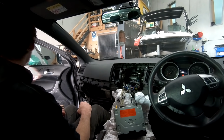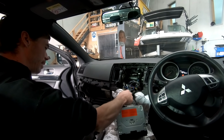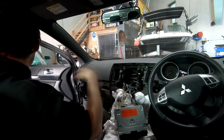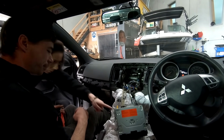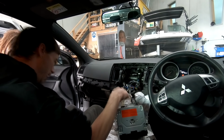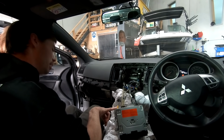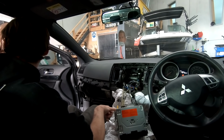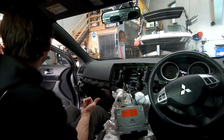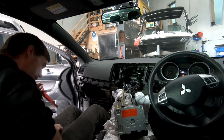Oh, cool. There you go. Are they to go to amps or battery? Yep, they're your signal wires, so they're the RCAs that actually give the audio signal to the amplifiers. Okay. What are these ones for? They're just extras. So that's plugged in there is the camera. Oh, okay. The yellow one, that's the camera. Yep. And then you've got AV input. Is that for video? Yeah, like if you wanted to input video into it. Oh, okay. Yeah, that's cool. I like that.